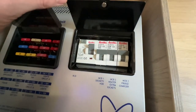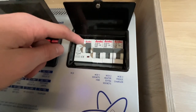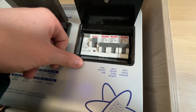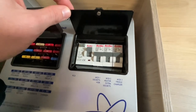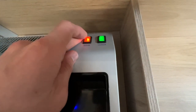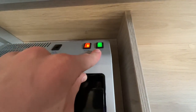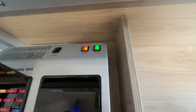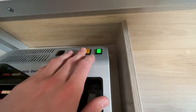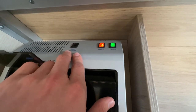On this side you have your main trip switch. If you're struggling and think the vehicle isn't receiving power, try the trip - if she trips she's receiving power, if she doesn't trip the motorhome isn't getting any power through the hookup cable. This needs to be pushed in and illuminated for the heater to work on electric. That is also your charger charging your leisure battery on mains. If you have any problems, this would be the first place to check - they should illuminate when hooked up.